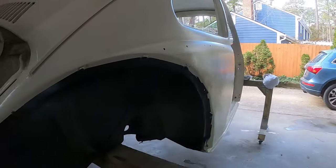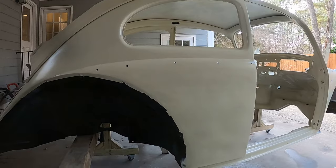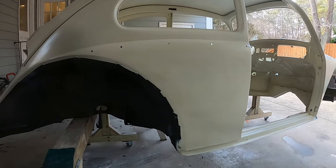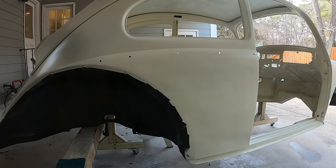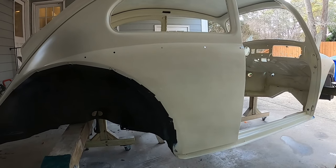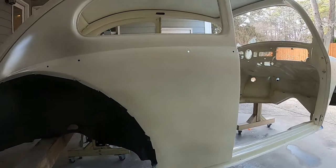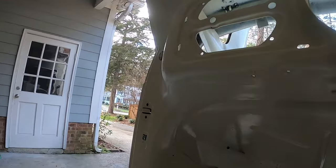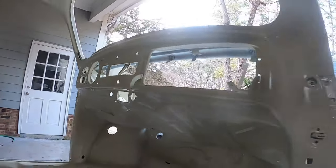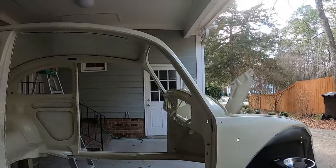I had to look up why paint crinkles. It's because if the undercoat is not already cured against whatever it's on, the thing that you spray over it tries to pull into it and it actually crinkles. I had one spot here on the corner and some spots under there. It's really just a matter of trying to paint the next coat on too quickly.